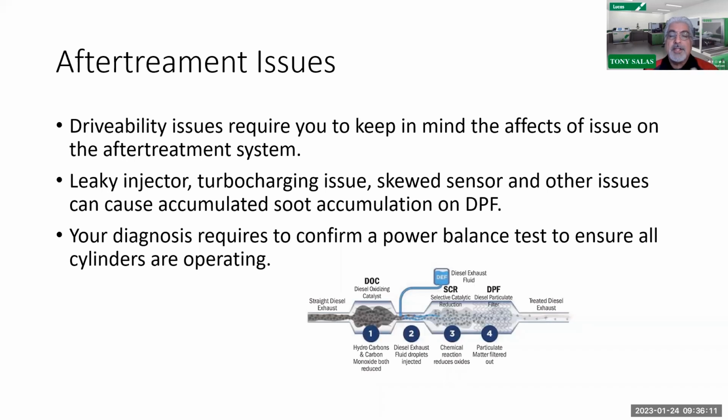So I guess what I'm trying to say is, for quite a while we've been telling you to uncork the exhaust. The problem on the L5P is this. Traditionally, on most trucks that have after treatment, we tell you to uncork the exhaust right at the downpipe. The problem is the L5P has the catalyst right next to the turbo. So how do you do that? Well, the problem is you can't.